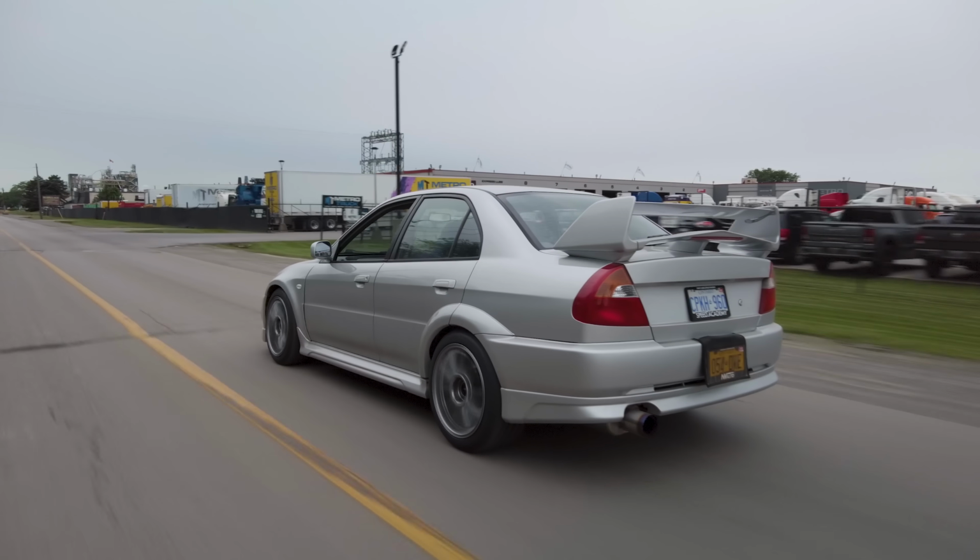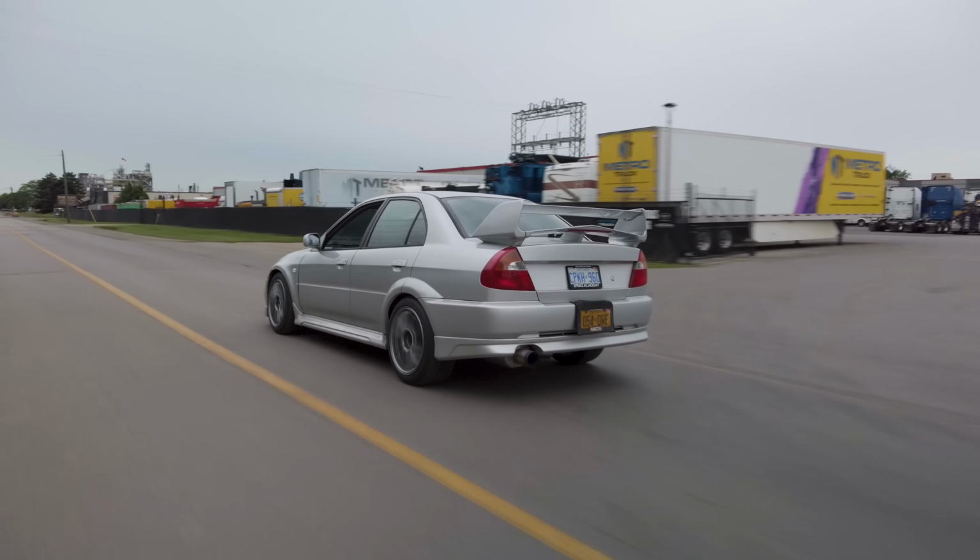Yeah, it really is a broad power band. This turbo, this G25 550, I think it's a winner, man. For this setup, a 2-liter turbo, it's perfect. It is perfect. With that 9.2 housing combined with that Arctec manifold there, it really is the perfect setup.